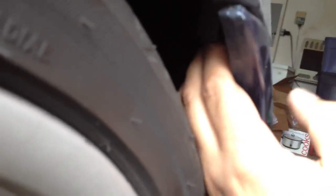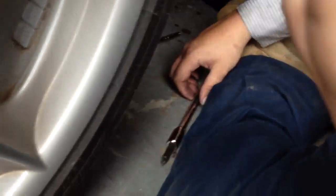Let's start on this side. First would be this number two Phillips — it's right at the top edge of this bumper cover back. Let's take that one out. The hardware will look like this, with a washer.